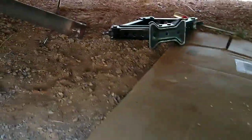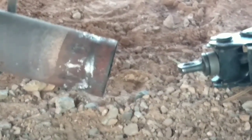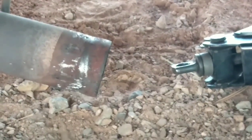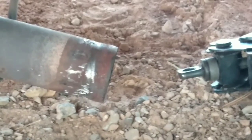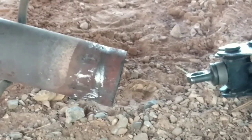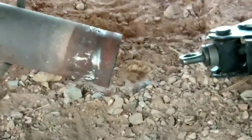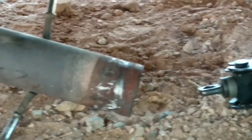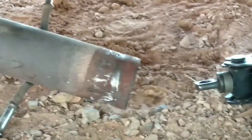My tailpipe has scratches, of course, but it does not have dents. If you go in a third from the end of the rust, almost to the middle, to where the rust line ends, you can see that the tailpipe has been compressed from the U-bolt they put on the muffler, and the tailpipe goes inside the muffler. They compressed that at the factory so tight that it's, I don't want to say dented or crimped, but there's a definite change in the circumference, between a third and halfway in on that rust line.